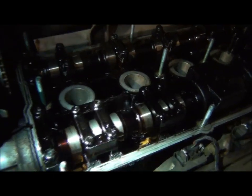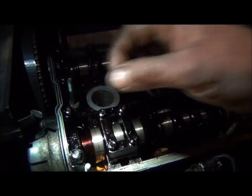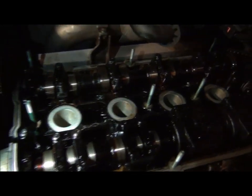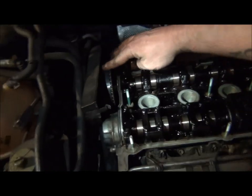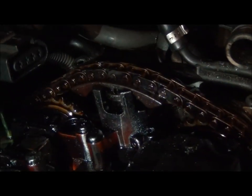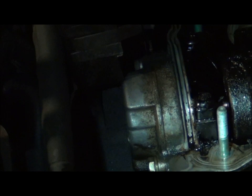For those of you not familiar with this engine, this is a 20-valve engine. You actually see three lobes here for the intake — there are three valves for intake, slightly offset, two up here and this one's back just a little bit to make room. Then you've got two for the exhaust, so five valves per cylinder opposed to the typical four. The timing belt drives just the one cam, and on the back side of the two cams it's driven by a chain. Keep an eye on the chain tensioner here — make sure the plastic piece isn't broken. With the sludge buildup I'm not going to press on anything too hard. I'll go ahead and pop off the camshaft position sensor while it's opened up and show you what that looks like.